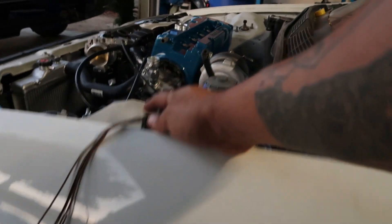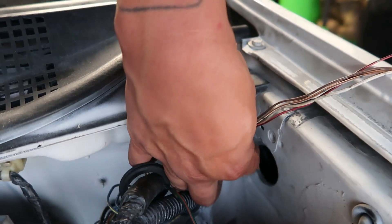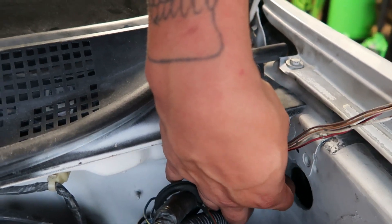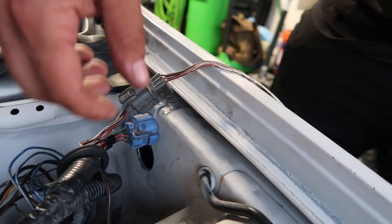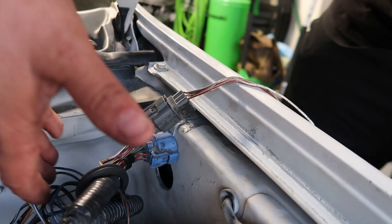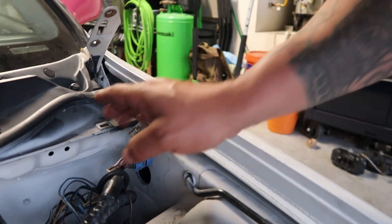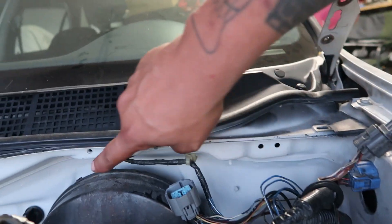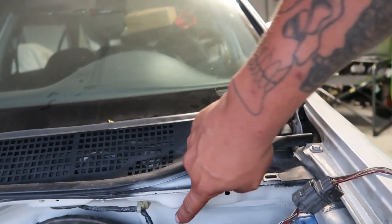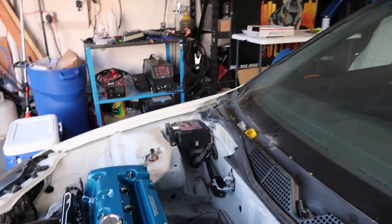Because I'm going to be putting these wires down through this hole that I drilled, I need to go a little bigger and find a two-inch grommet to cover it up. I want the wires to snake in through here. I'm most likely going to make a plate that bolts on here, held with silicone, so it bends through and tucks the harness out of the way. You'll probably only see the windshield wiper harness, but I'll be tucking that out of the way as much as possible on that same side too.